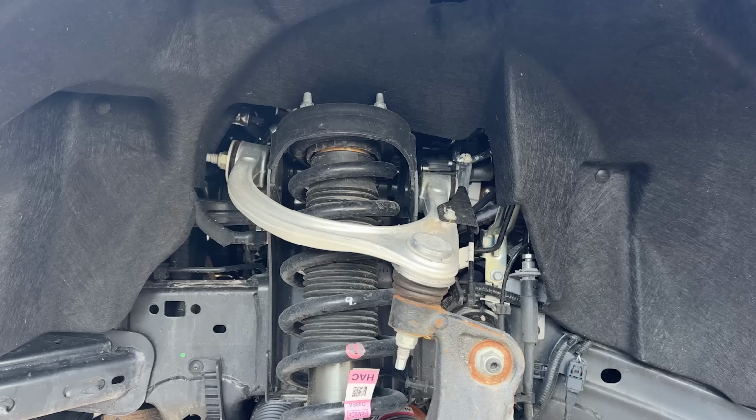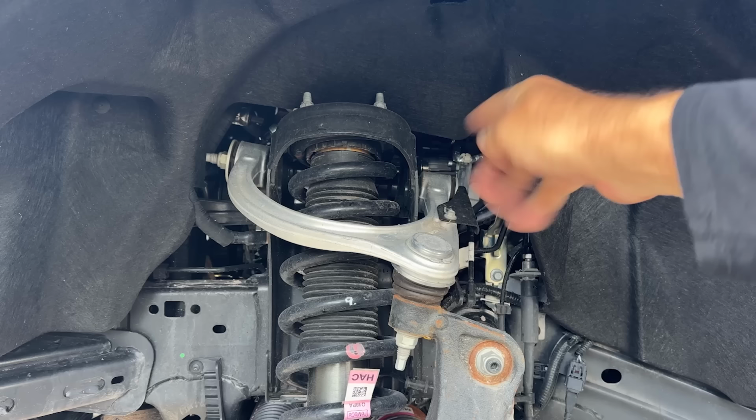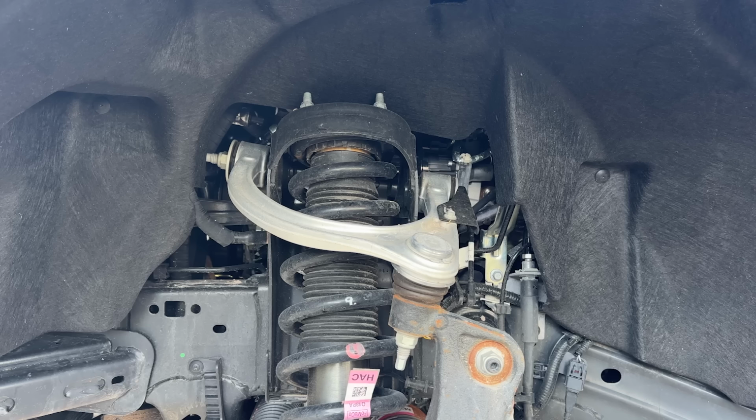As I said, this ball joint isn't really high enough that it's above the tire to be a true high mount upper arm. It's somewhere in the middle, but I think we're seeing why that is right now. This is pretty far back. They're trying to get a lot of caster angle here. And if this was higher for a given ball joint position, the caster angle would be smaller. So I think what we're seeing is a desire to have a certain amount of caster, and the high mount upper arm may not have allowed that.